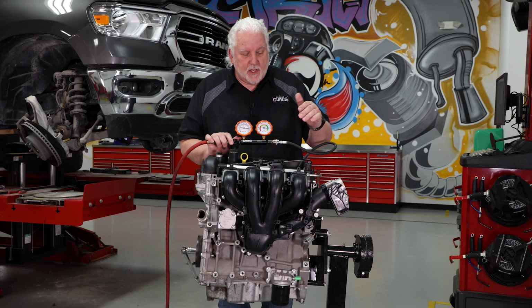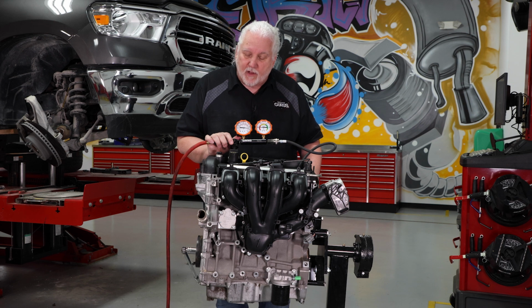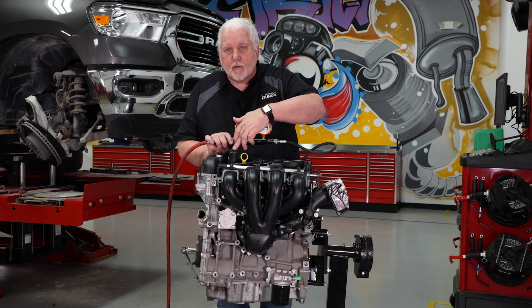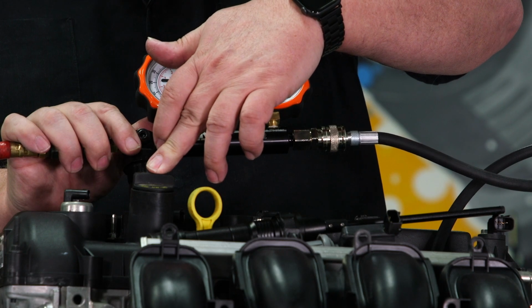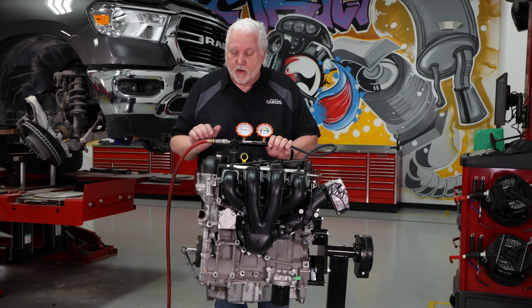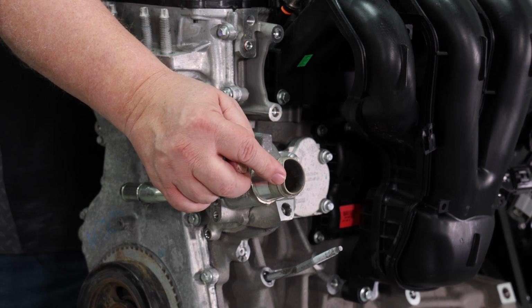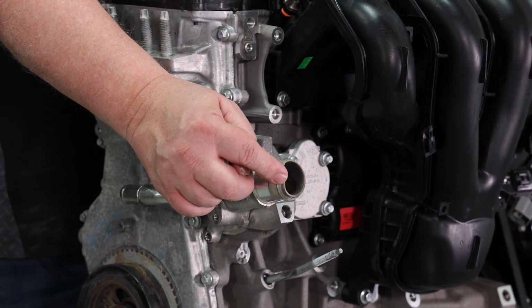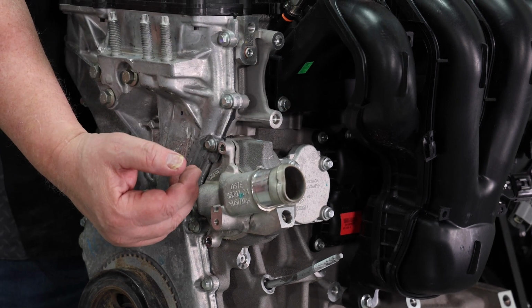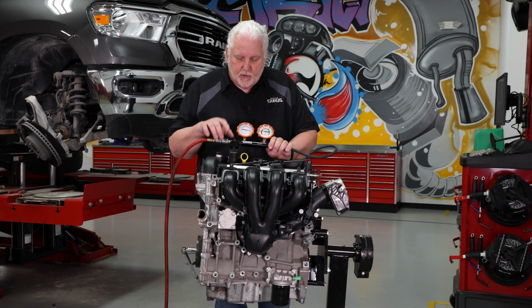The next part of the step would be to determine where is that leakage coming from, okay? Is it through the intake valves? Is it through the exhaust valves? Is it through the crankcase because the piston rings are leaking? Or is it the cooling system? You know, I got a head gasket leak where I'm going to have to look at, do I have air coming out of here? In many cases, the motor would be full of coolant at this point, so we'd actually pop the radiator cap and look for bubbles.